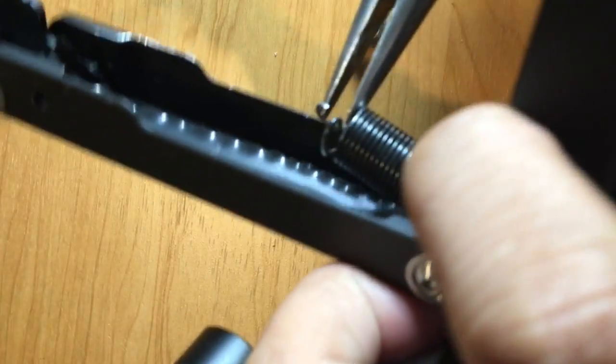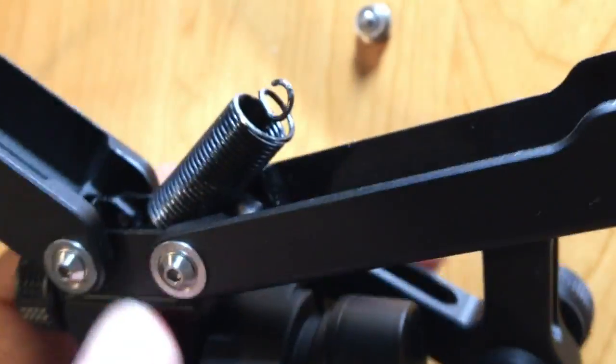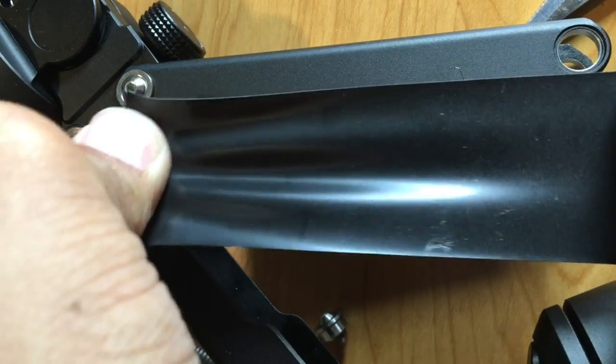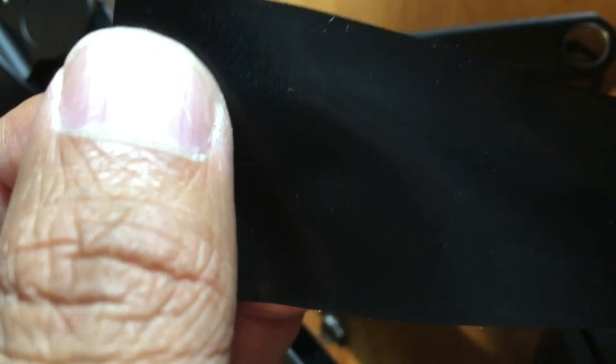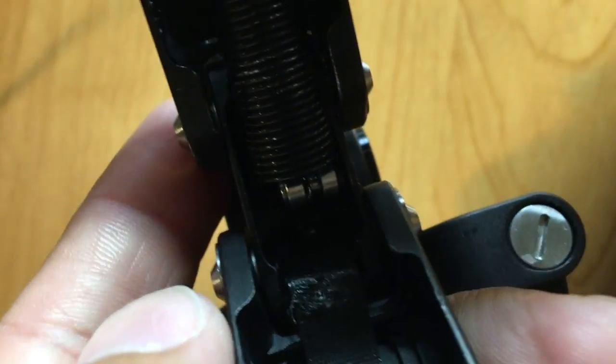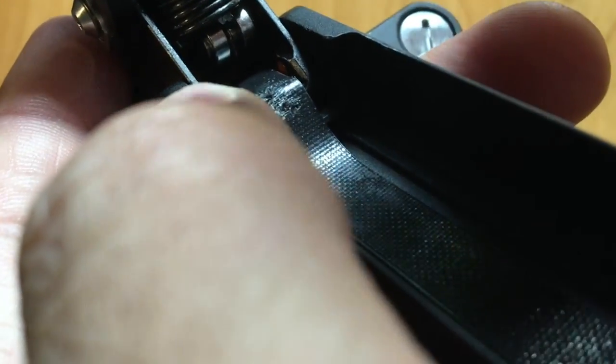You've got the top spring loose. Before you go to the second step, I recommend putting a little tape — electrical tape, because it's a little more sturdy. Measure how far you have to cut the tape, because there's a little strip of wire, and if you cut that it's not going to work properly. I recommend using duct tape or electrical tape so you don't hit those wires, because if you do, your gimbal is going to be useless.